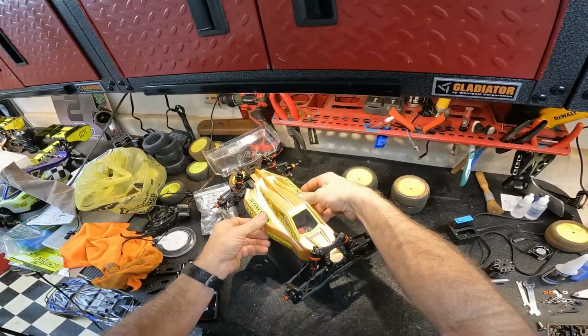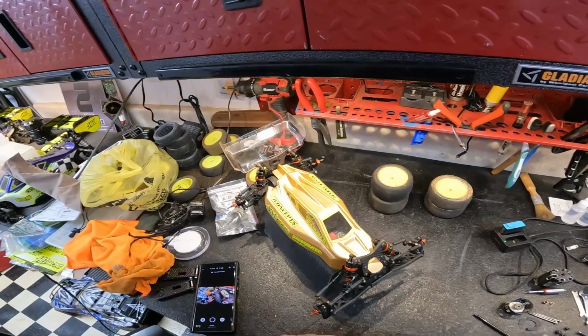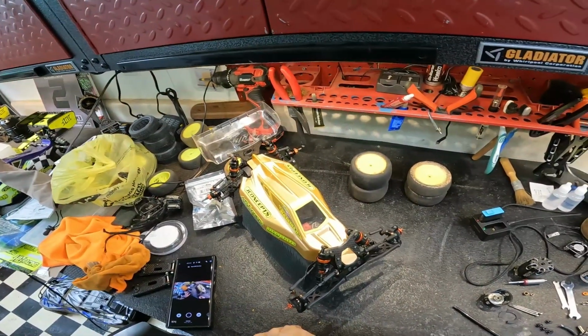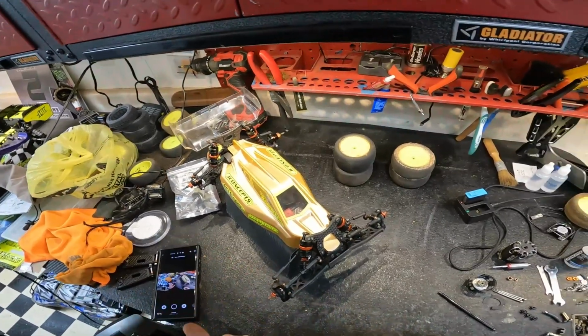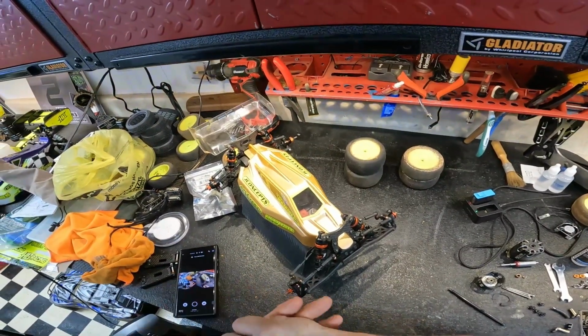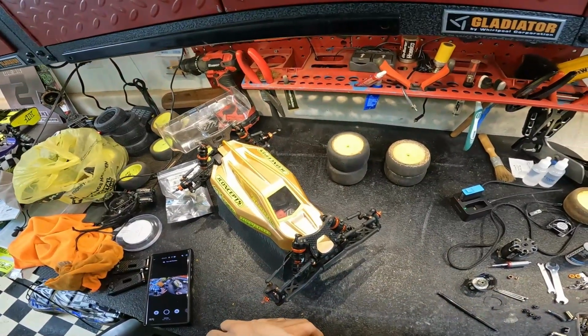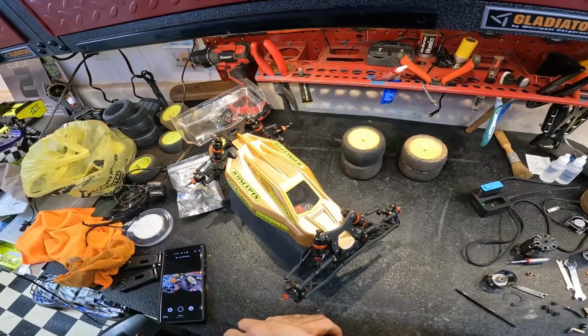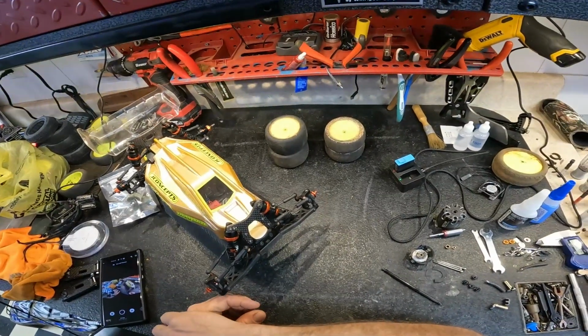This was on the second qualifier where I did this, and the car was flawless and easy to drive. I could run it pretty punched, and I had that 5.5 in there, so it had to be pretty easy. I also turned it down to 70% EPA to calm it down. But the car was so easy to drive and predictable, with incredible grip. It was pretty fast.